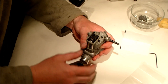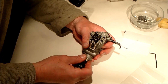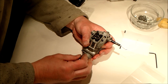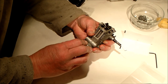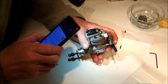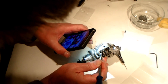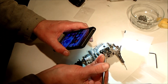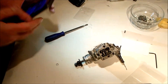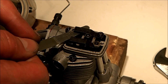I've not adjusted the valve clearances yet — there's plenty of movement in them. I've got it at top dead center at the moment, so that should be the neutral point where there's no pressure on the push rods. I'm just going to turn it through its cycle to make sure it does what it's supposed to. That seems to be doing that okay — push rods are engaged. I've also just noticed there's a lock washer floating around in there — that could have been nasty if it had been left in. Both valve clearances are set to 0.1 of a millimeter.